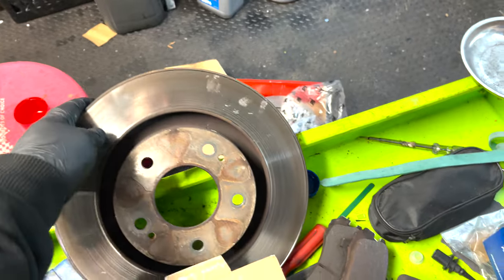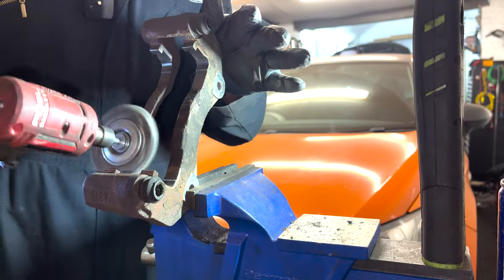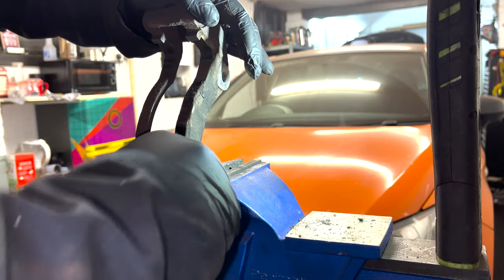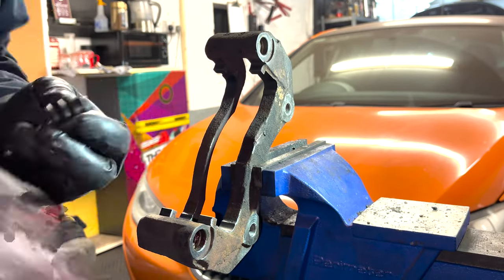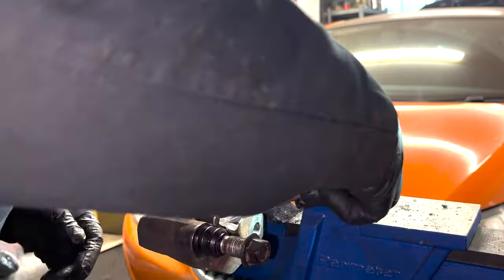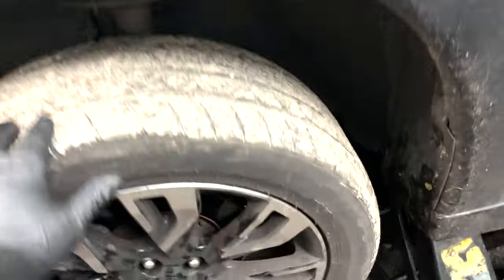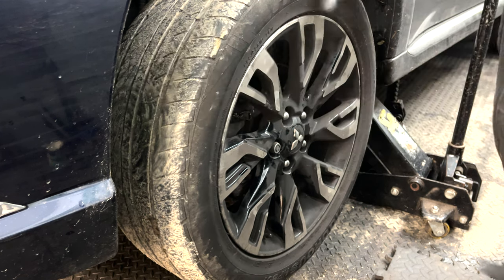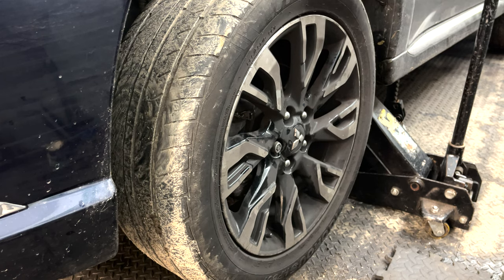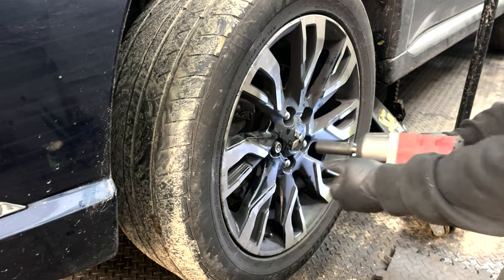When I got to this side I removed the caliper, cleaned the caliper brackets, fitted new hardware, greased everything, cleaned the slider pins, re-greased the slider pins, put everything back in. Then when I went to push the pistons in, I noticed it was seized up. As you can see here - let me put it on a tripod - the car is in park at the moment but it should be able to move a little bit, and this is locked. Locked up. You're going to see the condition of the brake disc - anyway, it all clicked in the end.